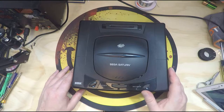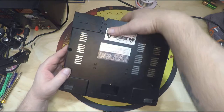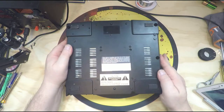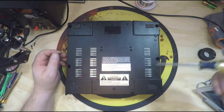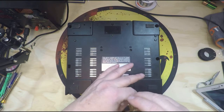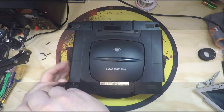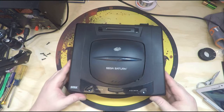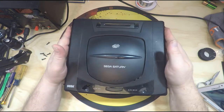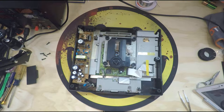Let's go downstairs, get this torn down and see what we can do with it. Alright, our Sega Saturn here. Let's get the top off of this guy and get her going, see what we can find out about it. There are five screws that have to come out. After you have your five screws out — I didn't think you really needed to see me unscrew five screws, I think everybody knows how to take out a screw — we'll just lift our top off and your little expansion door will come off right with it. Set that off to the side.